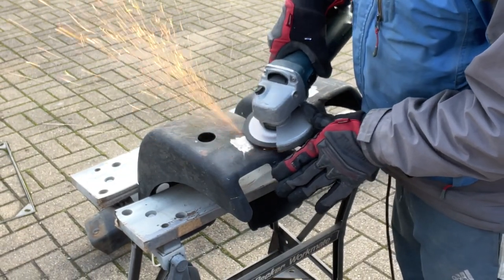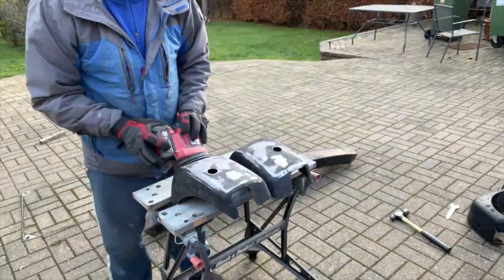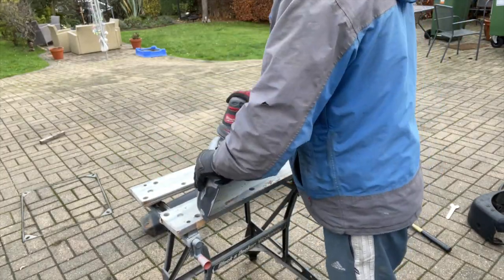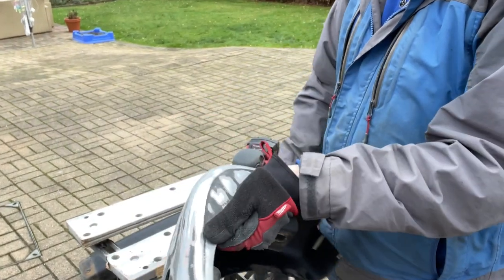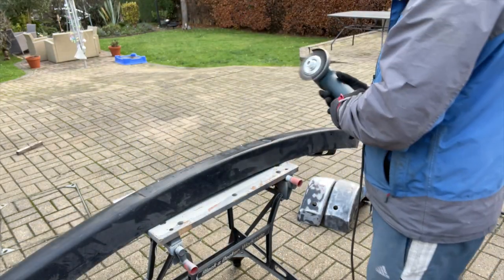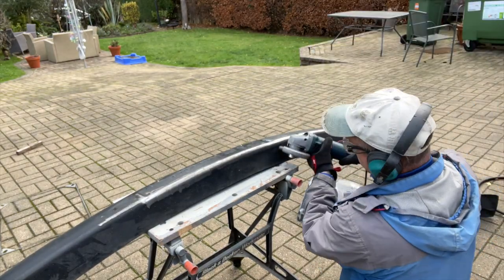We're going to fill these as well — just smooth it out with a bit of filler at the end before we actually do any paint work. I'm going to take these back and get rid of all this crappy paint that's on there. Here we go with the heavy grit on the sander — it's whizzing through that, look at that. There's about 10 layers of paint on these, it's ridiculous. I think someone's used a bit of Dulux on there at some point. The only thing is we don't know how it's going to react when we prime it, so hopefully if we can get most of it off we shouldn't have any problems. I've got my wire brush in the angle grinder and I'm going to pretty much take all of the paint off — really have a good go at this and get it right back to the metal. It's coming off really nicely, it really does take it back well.